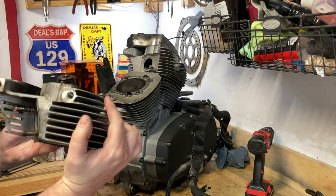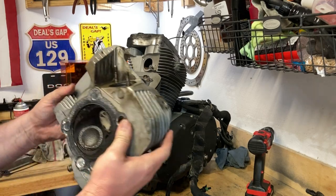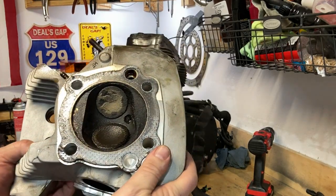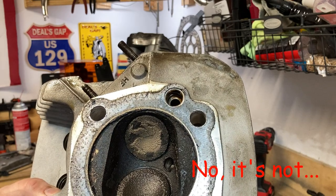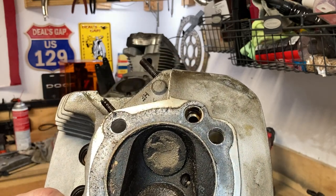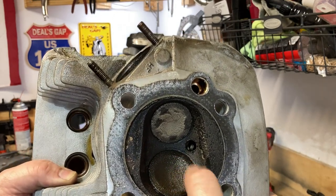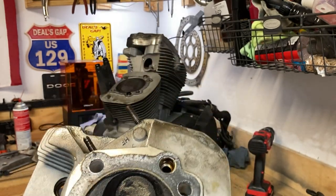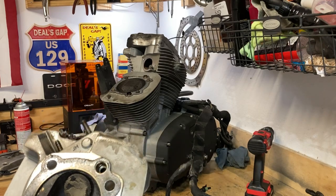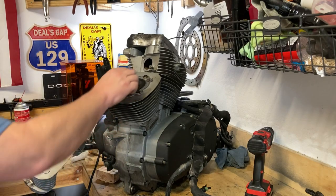So that's a lot of oil. Let me pour this oil out real quick. Let's take a look. That's quite a bit of buildup. I'm probably going to have to get new valves. What's interesting is this one's so wet — it's very shiny, and that's probably just raw gas being dumped in there. The reason I think that's the case is you can look at the carbon buildup on the piston head and you can see plainly — that's a lot.